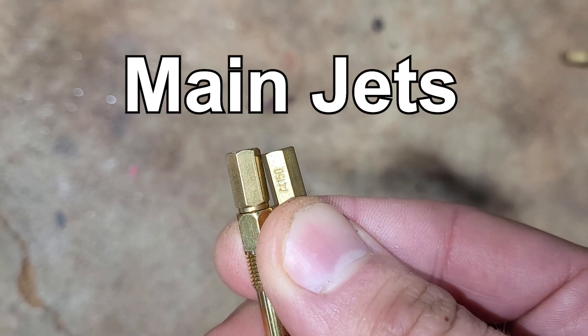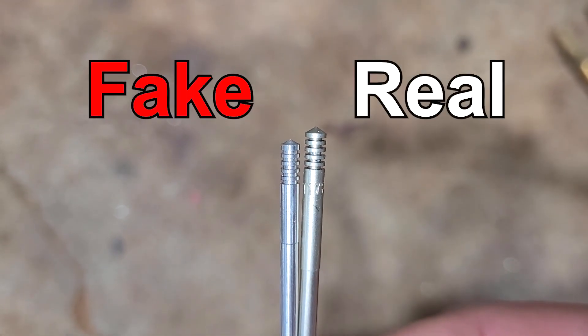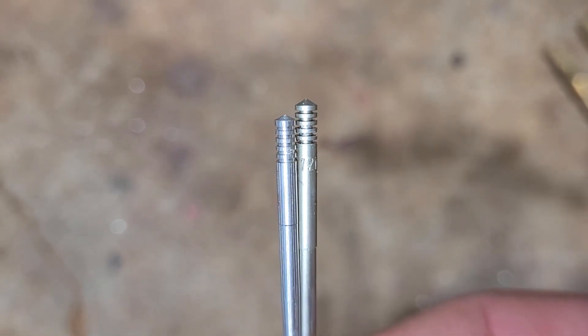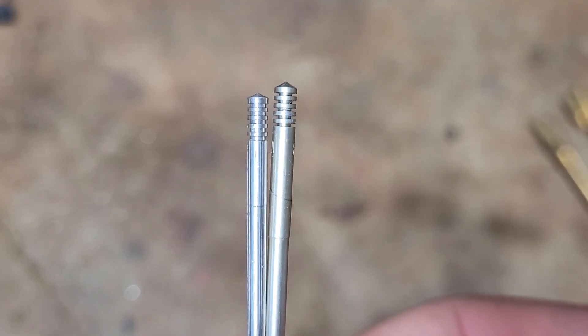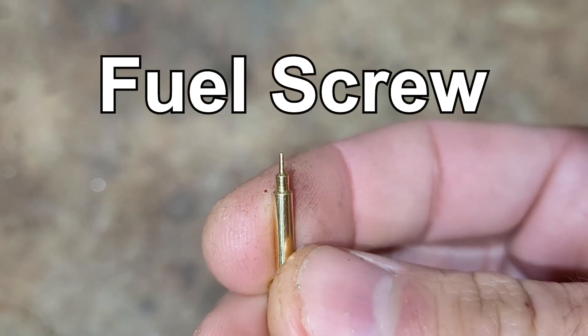Here are some main jets — you can see the fake one versus the genuine one. The machining is totally different, and that main jet is not going to be the right number. Here's a fake needle versus a genuine needle. You can see the genuine needle has numbers on it so you know what it's supposed to be. The fake one doesn't have any markings, and if you look closely you can see machining marks — lines all down it. That's not going to work at all. The genuine one is perfectly machined, and that needle is not going to have the right taper. The emulsion tube and fuel screw are no better either — you'll never be able to get it tuned right. That idle screw is not going to have the right taper; you'll never fine-tune the carb with this thing.